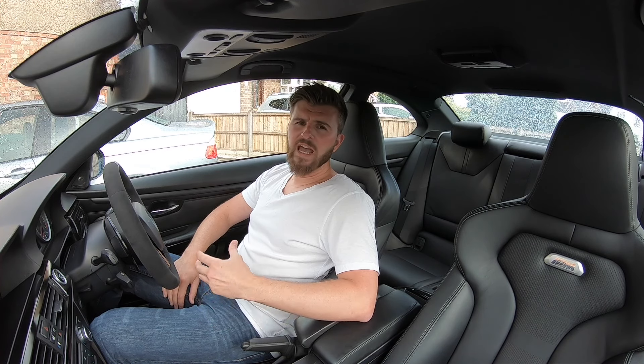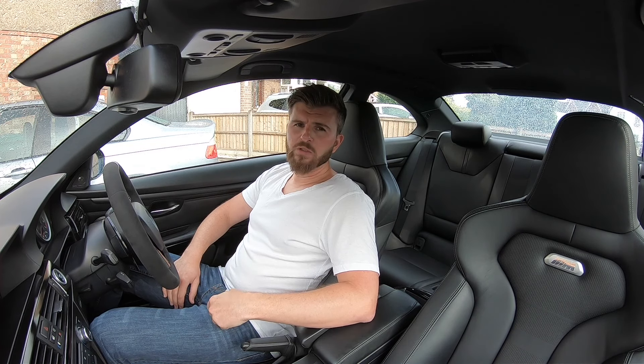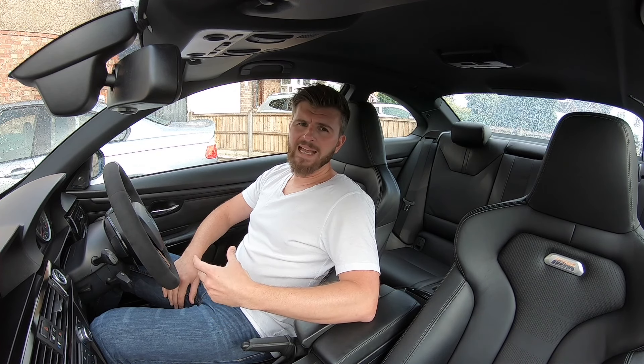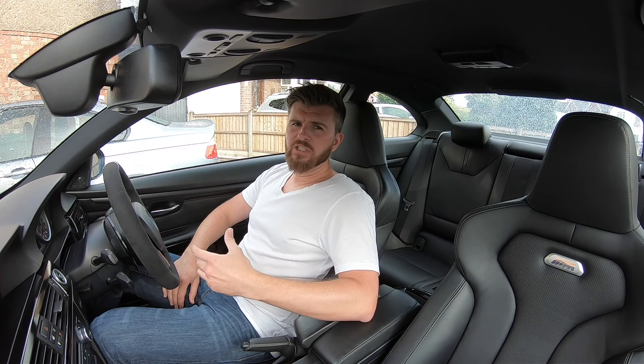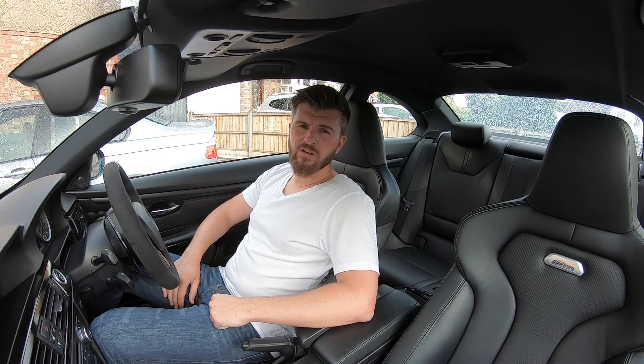You'll be greeted by the yellow main plug — the harness to the car. You just need to lift the tabs and the little plugs inside for the airbags, pre-tensioners, and all the module wires slide out, leaving you with a black connector — I think it was a blue or grey one for the airbag. You then undo the buckle from the E9 series seat to transfer it over to the M4 seat.